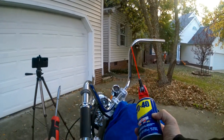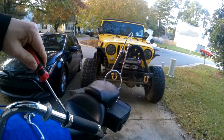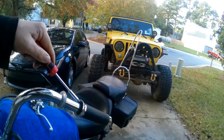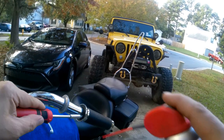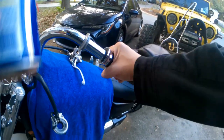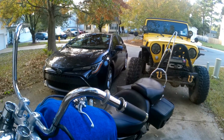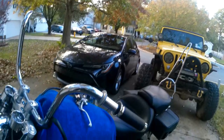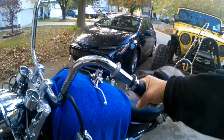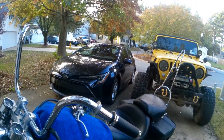To remove the grip while preserving it, we're going to need a flathead screwdriver and our WD-40. Take the flathead screwdriver, stick it between the grip and the bar, and shoot a little WD-40 in there. Come around the other side, add a little more WD-40 in two or three spots, and then just start working that grip back and forth. Once you get enough WD-40 in there, it's going to start eating away at that glue and you can just keep wiggling and that grip will slide off. Don't forget your bushing — take that off too.